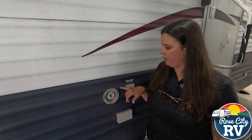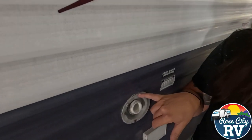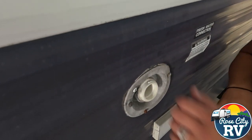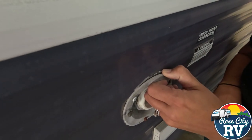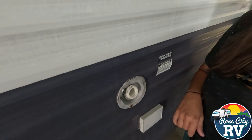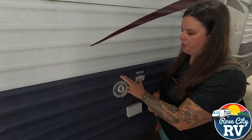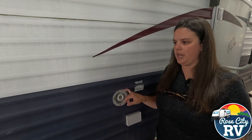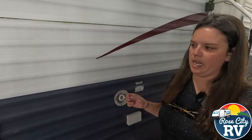What I'm looking for is — as you can see here — this old putty or butyl tape that's cracked right there. This one's super obvious because we actually have a real void in the sealer where you can clearly see where water is able to get in. When looking at our sealers we're going to be pushing and pulling on the materials to make sure we are making a seal at all times. Obviously this one is not.